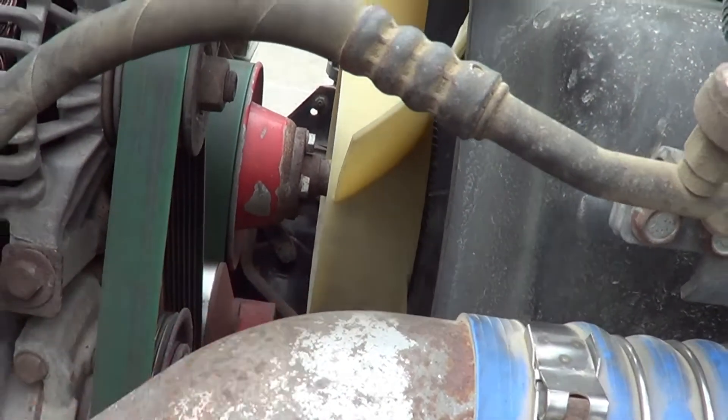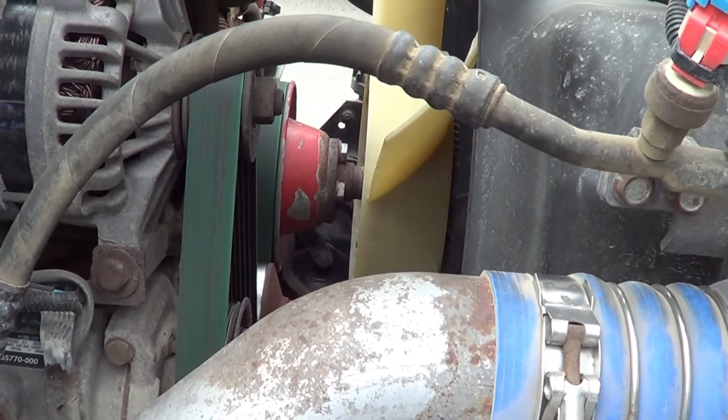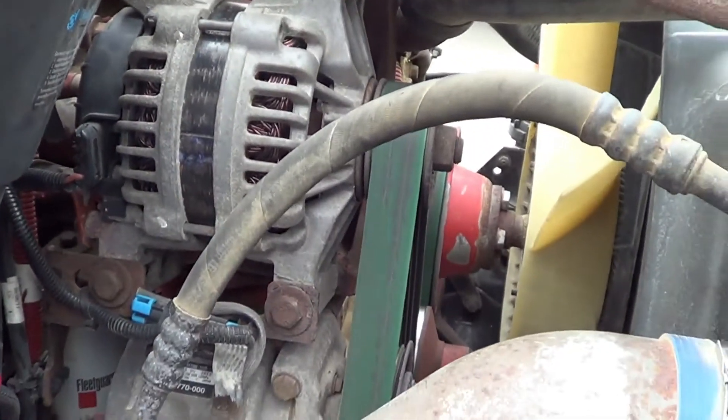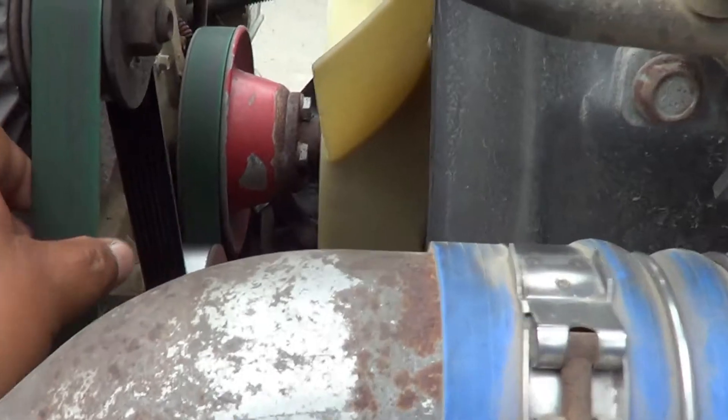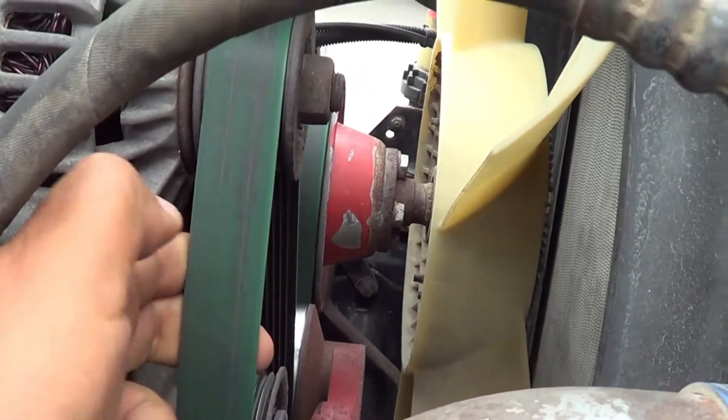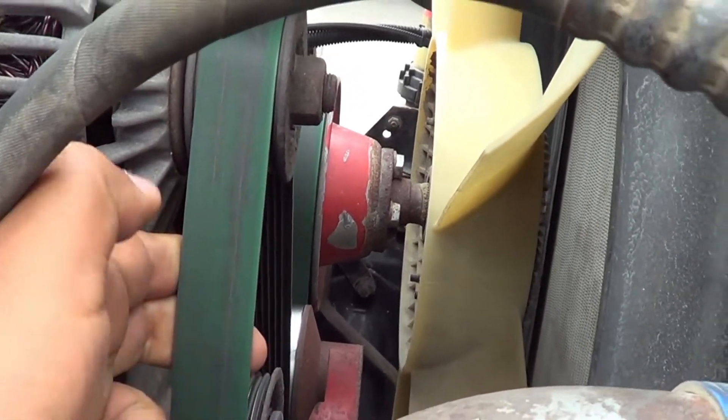Now I'm going to look at my vehicle. I'm going to make sure my vehicle is not leaning to either side, indicating a suspension problem — it could be a shock absorber, a leaf spring failure, a flat tire, or my load is shifting. I'm going to look under my vehicle to make sure there are no puddles indicating any type of fluid is leaking, and no hanging hoses or hanging wires.